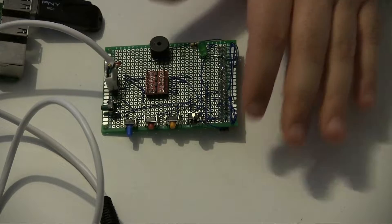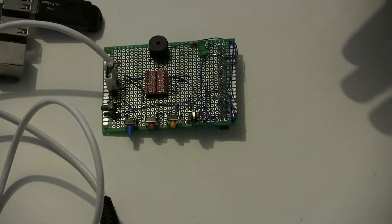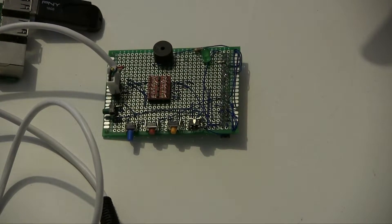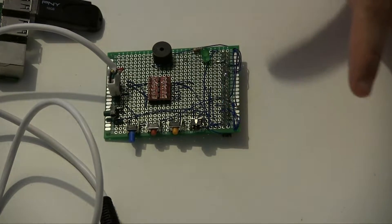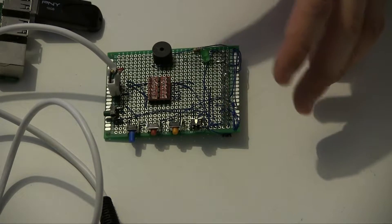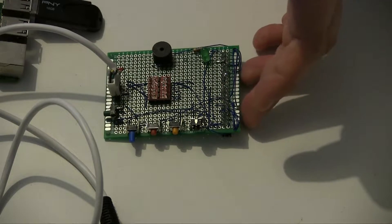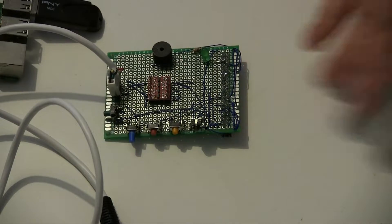This device, because it's designed to fully emulate that drive, acts exactly like that drive does. The fact that the 1541 was a full computer was taken advantage of by a lot of game manufacturers — they used it to do special turbo loaders, encrypted loaders, and forms of copy protection. Because of that, those games do have issues running on other solutions. There are hacked ROMs which let them run, but with the Pi 1541 you get to run those games exactly as they would have on an actual 1541 drive, which is pretty cool.